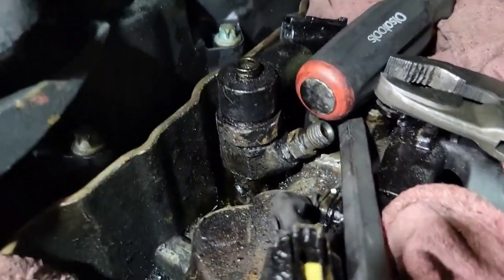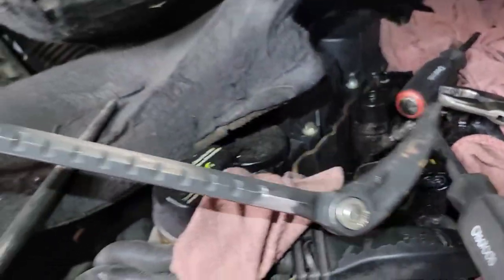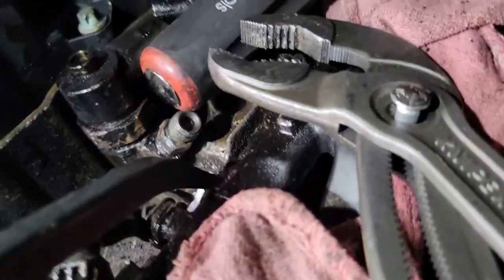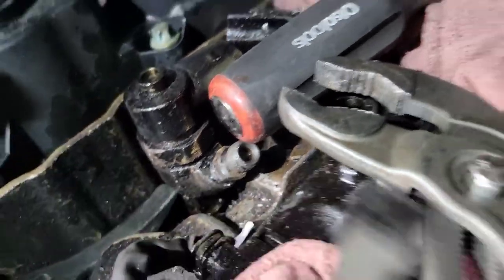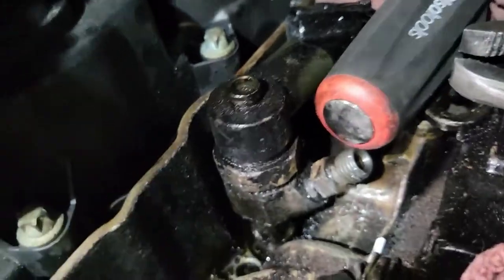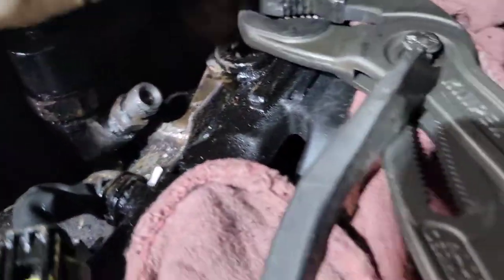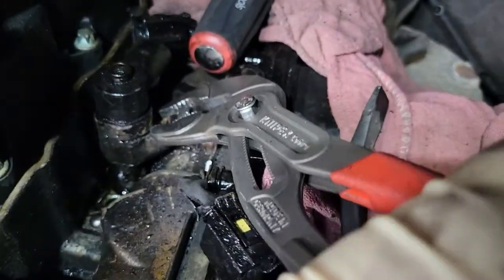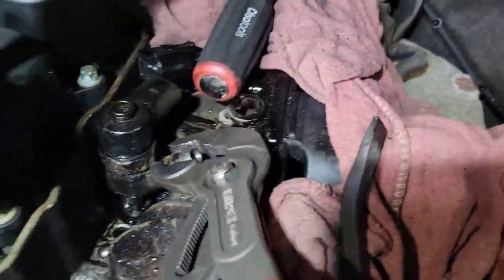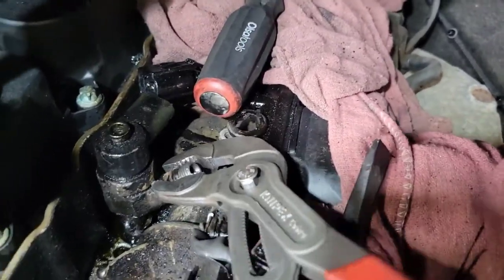Here are the different things I'm using — you can see that injector is up about three-quarters of an inch. I've got an adjustable pry bar on the back edge and another pry bar on the other side, wiggling the two to get it to break loose. But before that, I sprayed penetrating oil down at the base of the injector, then grabbed it with my Knipex pliers and was able to turn it, hit it back, turn it back — doing that repeatedly until it got a lot looser and easier to twist, then started working it with the pry bar.